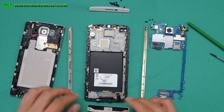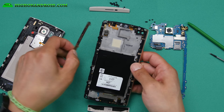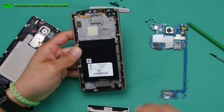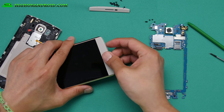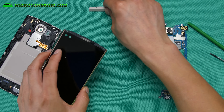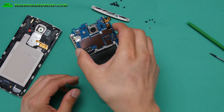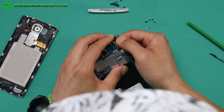Alright, so let's go ahead and reassemble our phone — it should be pretty easy to do. The first thing we're going to do is obviously put this frame back on. Put it in here and slide it up so it aligns with the screws. This one — carefully place it in there, slide it up, and once it's slid up it shouldn't pull out. Next, we're going to go ahead and put the bottom part back on — simply place it right over and snap it in there. I love LG products because they're so easy to disassemble — there's actually nothing to it. Make sure the cameras are in there.